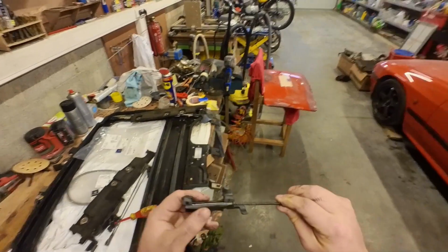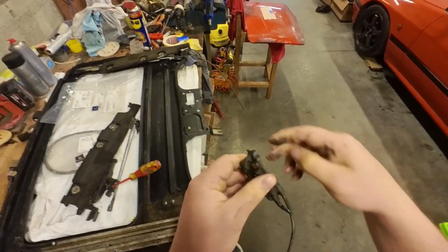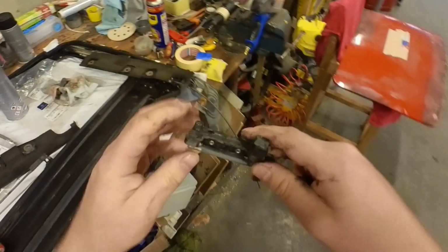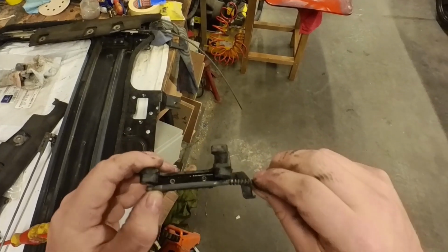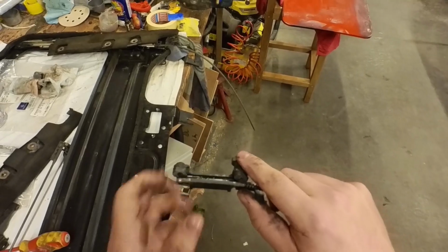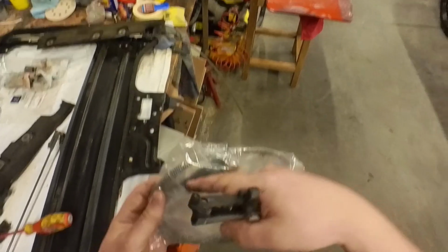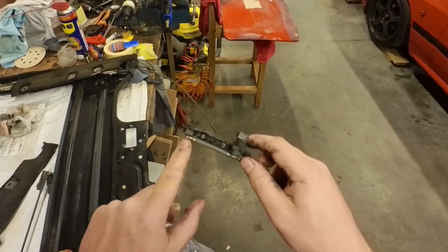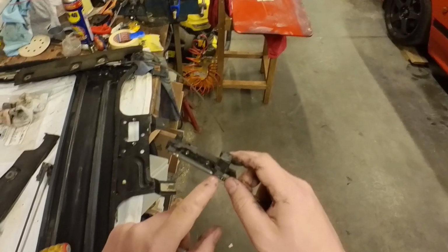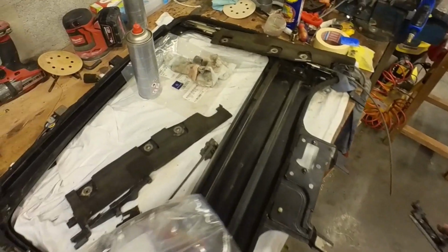So basically, to replace this old Mazda wire with the Mercedes wire, you cut. This is actually a metal piece. Let's just maybe clean it off a bit. As you can see, you have this plastic piece here, and then this metal piece. These are some metal crimpers that connect onto the wire. Cut it here, then you can remove the wire, and then I'll show you in a bit. You cut off the Mercedes slider, remove 2 layers of the outer wire, and then you're left with the inner wire, and that inner wire slides in this track, and you make new metal crimpers, and then you can just crimp this on, and it actually worked on that side.